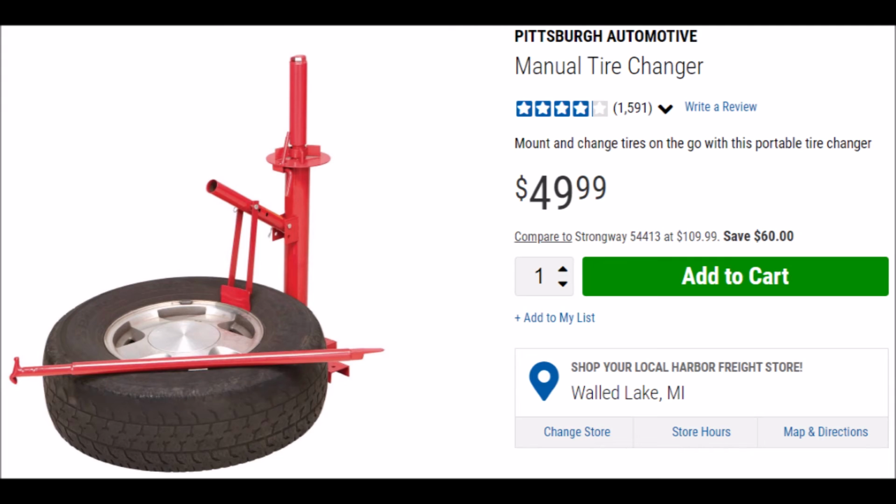To get the old rubber valve out and the new metal valve in, we need to get part of the tire off the bead of the tire rim. For that, we use a tool from Harbor Freight, shown here. You can use wire clippers to cut the old tire valve off and then push it out through the rim, or pull it out from behind using a set of pliers. Then insert the new metal valve in from behind and use the washer and nut to secure it.